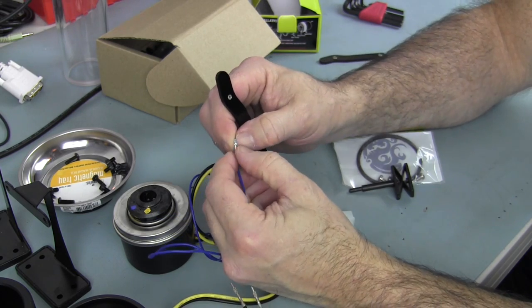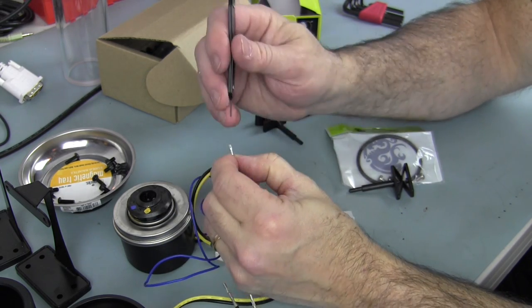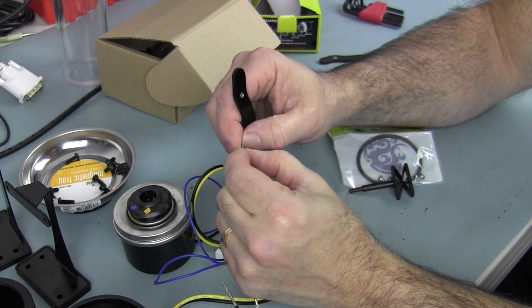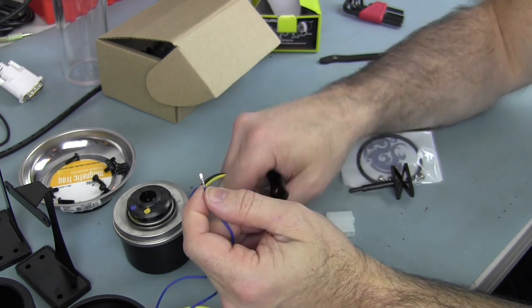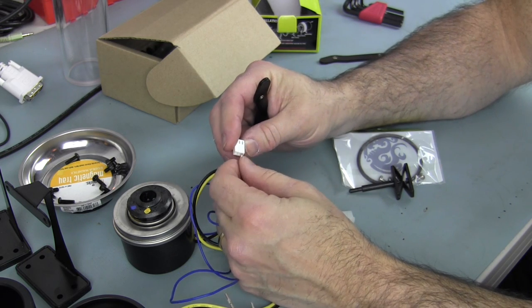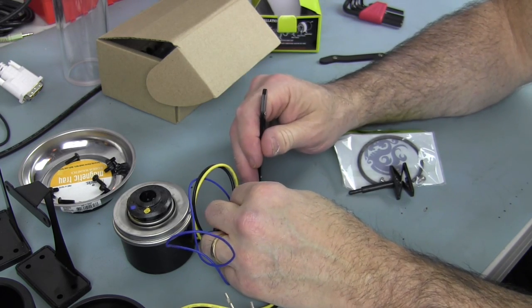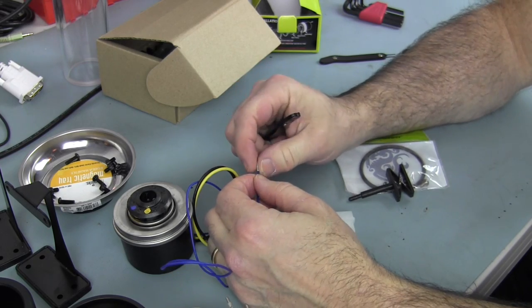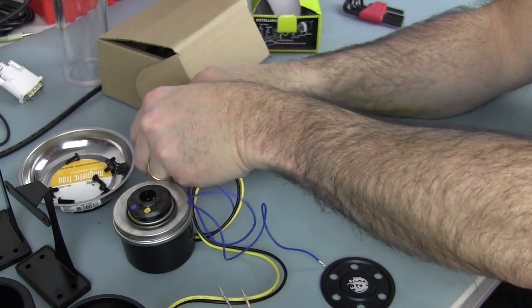Inside the area where you can see the pin, you use the tool to press down on the tiny little flange. There's a little flange that needs to pop back up, so you press it down and then you're able to get the pin out. It just compresses it, so when you reinsert it the pressure will pop back up. You just put some pressure down, bend the pins, and they slide right out. So we now have the connectors removed from the power and RPM signal pins.